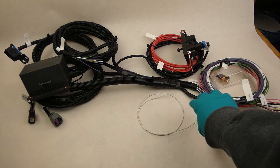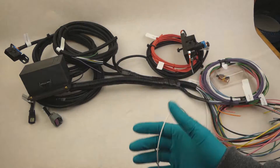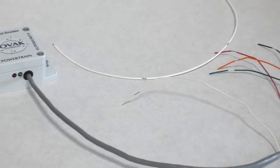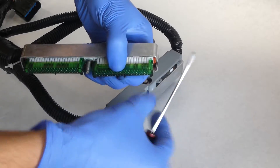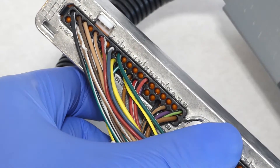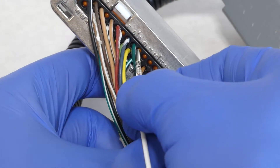If you purchased a Novak wiring harness, this is already in your harness as a white wire labeled TAC. Otherwise, we have included a white wire with the PCM terminal pre-crimped. For 1999 to 2007 Gen 3 conversions, this wire goes to pin 10 on the red or green connector. For 2008 to 2014 Gen 4 conversions, this is pin 48 on the black connector.